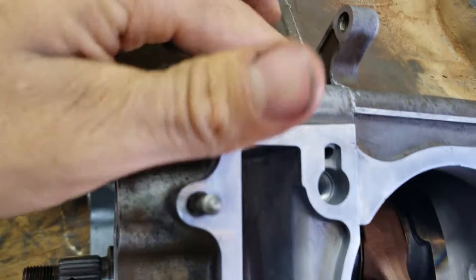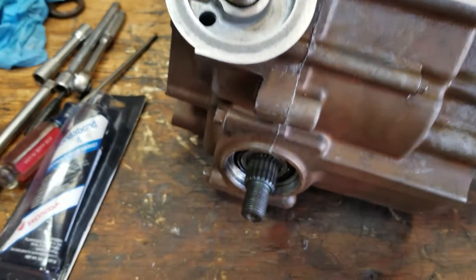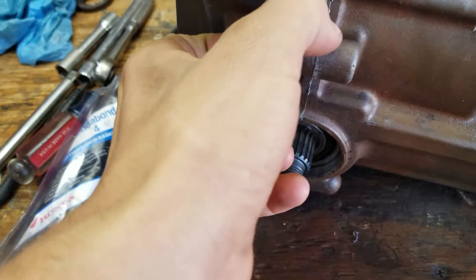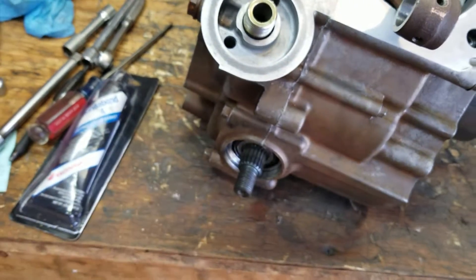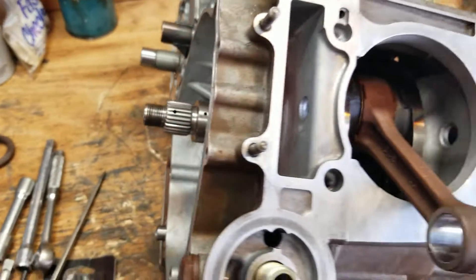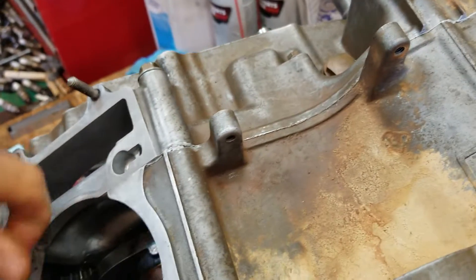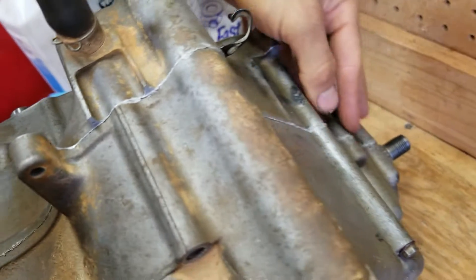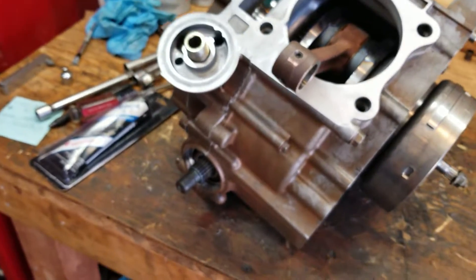It's the next day here and it's all done — it's all sealed up. All the bolts are in and torqued down. This stuff is weird — I know I keep going on about this sealant, but it's not just like silicone; it's almost like a clay. That's why I guess they call it non-hardening — it stays in there and doesn't get hard and brittle. That's definitely the absolutely purpose-built stuff for this application. Definitely don't use silicone or anything else — this is totally 100% different.